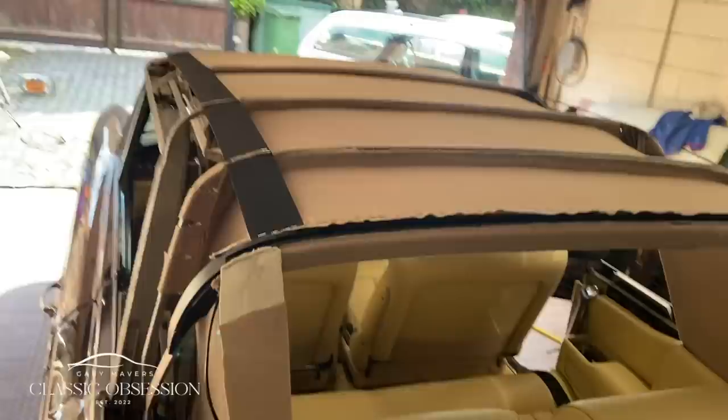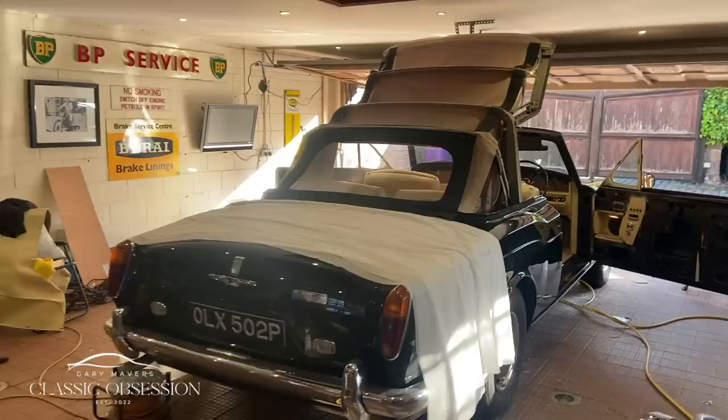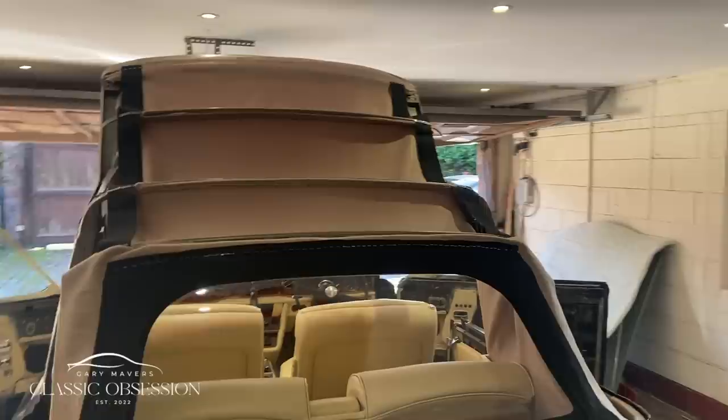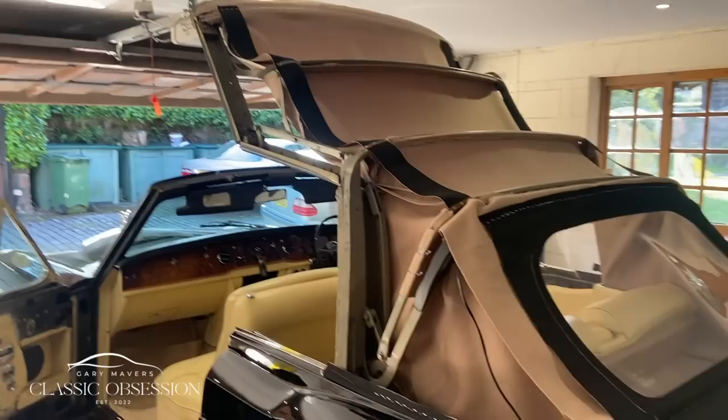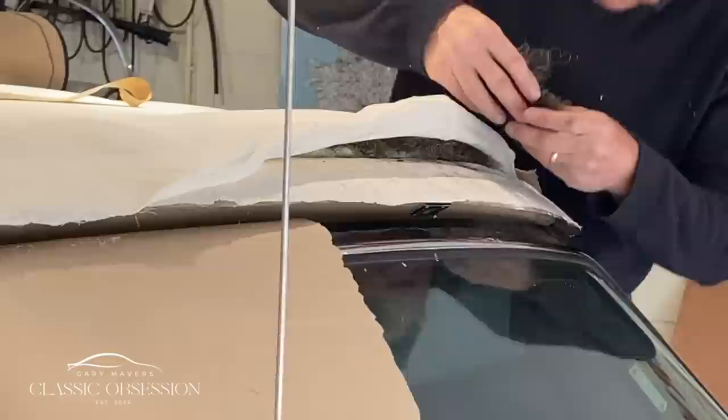After taking the hood up and down a few times just to make sure there's no movement, I'm now happy this is a great foundation for the hood that's going over the top. The rear window is centralised and fitted, making sure that when the hood is fully erect, the window is tight and wrinkle free. I then make the hood padding using three-quarter-inch sponge covered by a cotton sheet. In hindsight, maybe I should have used a quilt-type substance filled with hollow fibre — this normally gives a better look — but if it's something I'm not happy with, I can always rectify this at a later date.